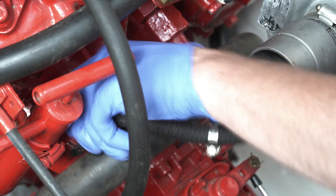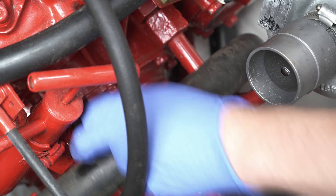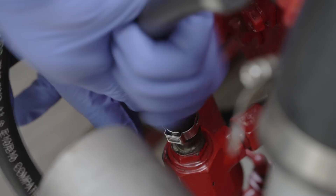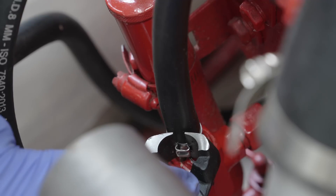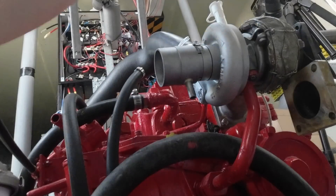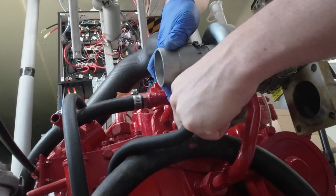The breather line would have probably survived nearly forever as it doesn't channel fluids, but if I'm swapping out new hoses I might as well do them all. Since the diameter of the hoses is quite narrow, I'm not reusing the old jubilee clips, as apparently the smaller ones don't tighten into a perfect circle. Instead, stepless single-ear O-clips. The bottom one was very pleasing, but the nipple at the turbo end turned out to be very slightly larger.